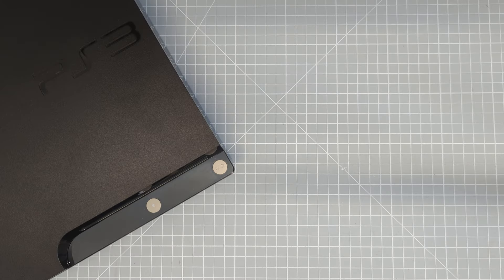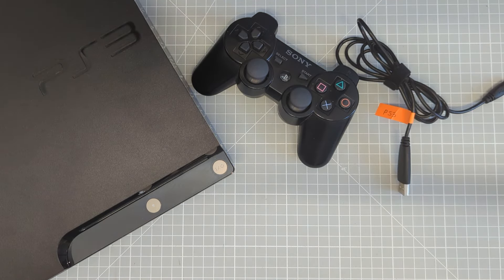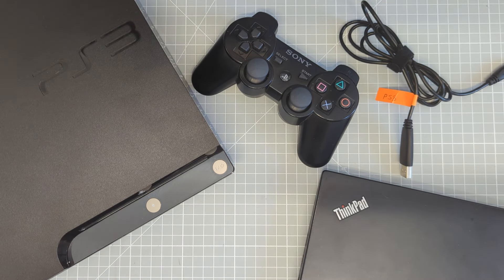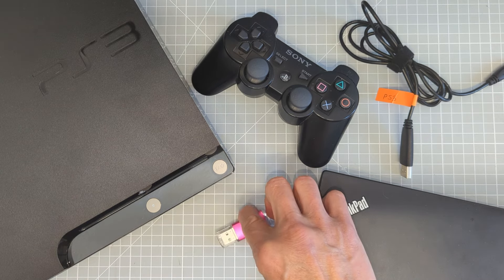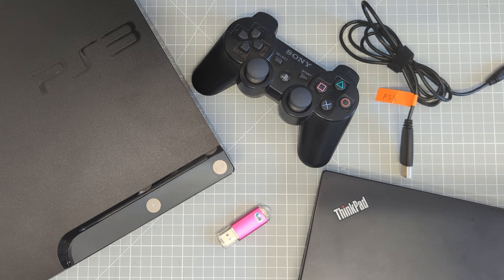You're also going to need an original Sony PS3 controller and the mini USB cable that allows it to connect directly to your console — one of the areas where we need to boot into safe mode requires that. You'll also need your PS3 connected to the internet, as we need to download some files and access some websites on it. You're going to need a PC to download some software and prepare a USB drive, and you'll need an FAT32 formatted USB drive. I have made a video showing the full drive formatting process, so please do have a look at that if you're not sure how to prepare your USB.